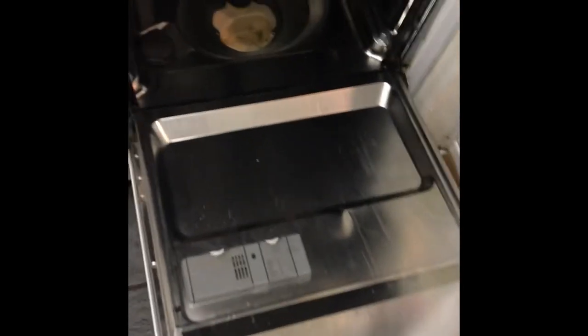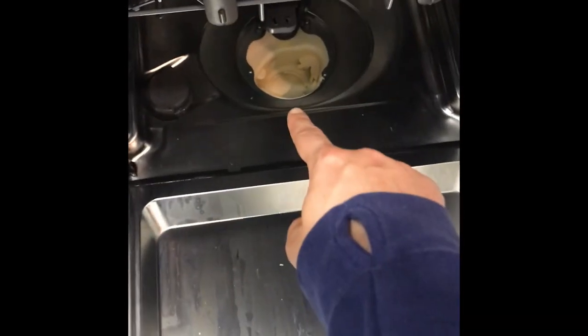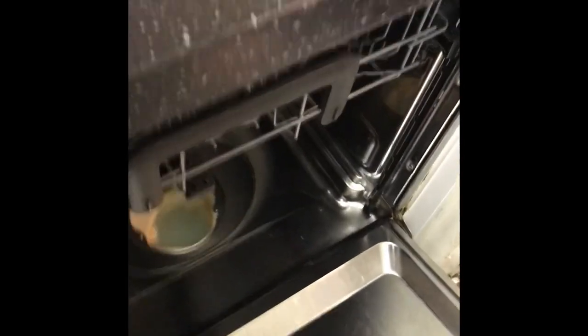At that stage just remove the obstruction, put the panel and the door back on. With the cover and door back on, the last thing you want to do before turning it on is to refill that hole with some water. There's a sensor in the bottom that won't allow the dishwasher to turn on unless it is full. So just put a couple of bowls worth of water in there.